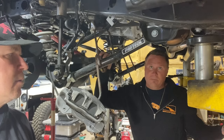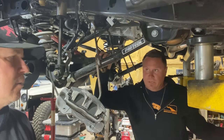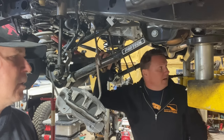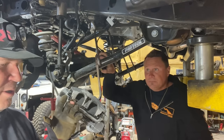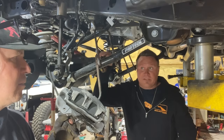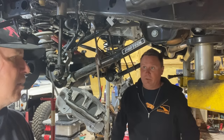We're gonna make sure that we match the pinion preload resistance on the rear. And okay, that's gonna go by feel, but we're also gonna take a measurement on it. So the preload is like how tight the bearings are. Exactly, yeah. If it's over tightened, then there's not enough room for oil to get between the rollers and the race, and kablamo, thing blows up on you.